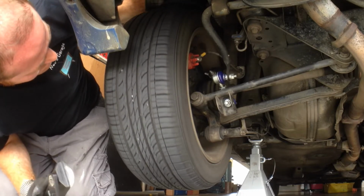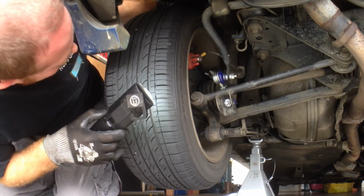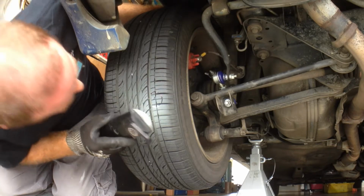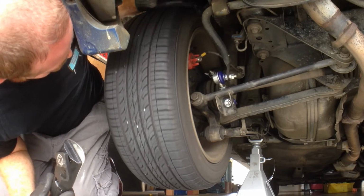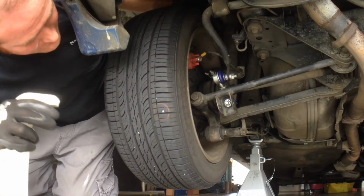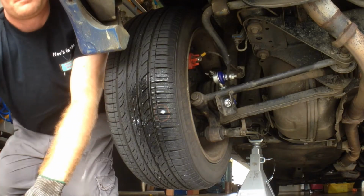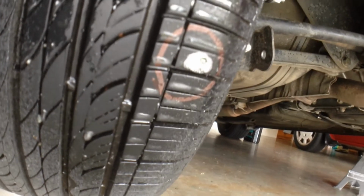Most of this is just gravel stuck in the tread. Looks like a bit of glass, we'll check that out as well. So what we need now is just a squirty bottle of soapy water. And yeah, there's our leak. See it there? Frothing up like a 7-year-old waiting for the next episode of Pokemon Go.